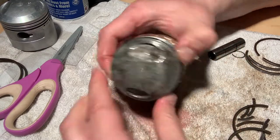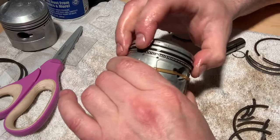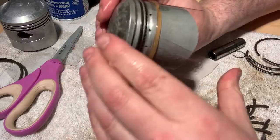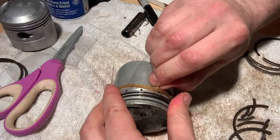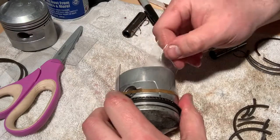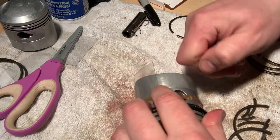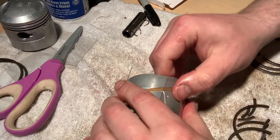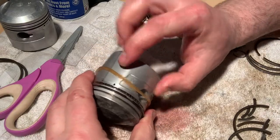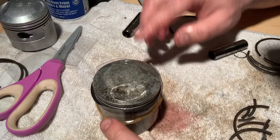Then we get our compression ring in and that is going to be absolutely beautiful. These are stock pistons so I just have the normal replacement kit. Now let's go ahead and install that last one. I'm going to pull my plastic pieces back up just like that. I got to put one back in. Get that rubber band down - my hands are so greasy right now. I'm going to give my hands a wipe. I'm going to note where that gap is and just alternate that so we don't have those gaps in the ring showing up all over the place.